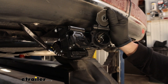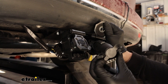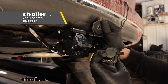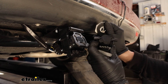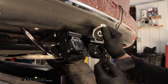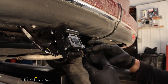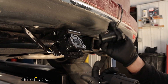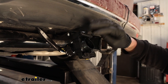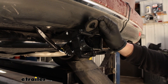Another reason would be maybe the seven-way on your vehicle right now is just your standard seven-way and you don't have that extra four-way. You tow multiple trailers and you're tired of using an adapter like this — these are available if you have just a seven-way and need to tow a trailer with a four-way flat. But it's just one more piece to keep track of and one more potential link that could fail in the wiring system. So by removing the old one and popping this one into place, that'll eliminate you needing a seven-to-four adapter and you can tow both types of trailers by just plugging them right in.